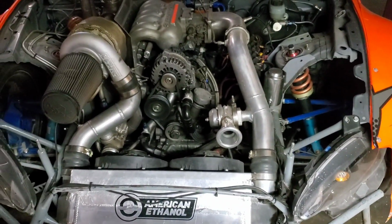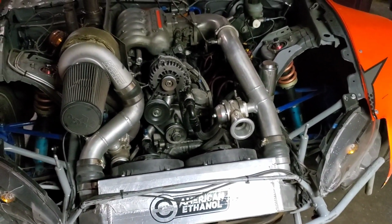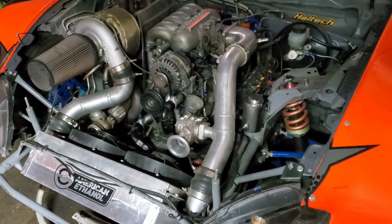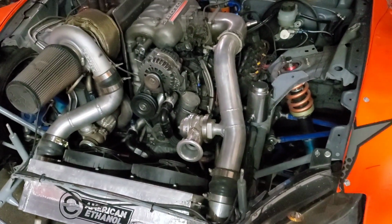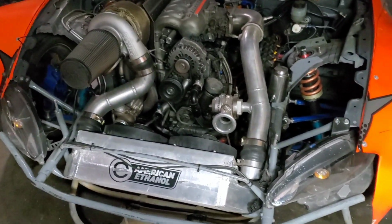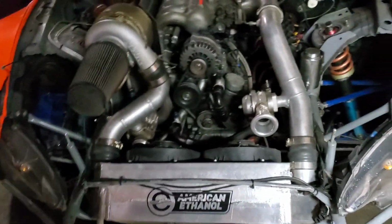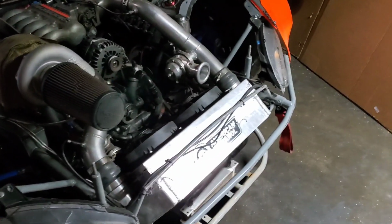Rotaries, especially, have a lot of oil temperature being built. Although you do need a massive radiator on any rotary or any race car, we've come to realize that especially with high horsepower rotary setups, to dissipate the heat from the motor you need to dissipate that oil temperature as well, because the rotors are oil cooled in a rotary. You could be having water temperature issues, but it might actually be because you're sustaining high oil temperatures coming out of those rotors. With this setup, we found success with a stacked setup up front versus the traditional drifting V-mount setup. Although our intercooler air is passing through our oil coolers, we are getting the proper amount of cooling, and this was a very efficient setup, running 2 double pass oil coolers with -10 lines.